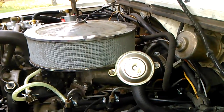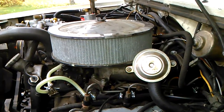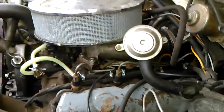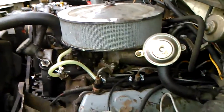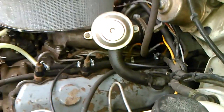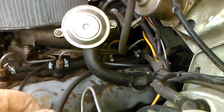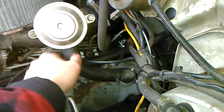I personally don't like that for this truck at least because it's got some blow-by and it makes me think something's on fire. I accidentally forgot to put this hose on one time and it was smoking from under my hood — it was just blow-by coming out of that tube and I thought something had caught fire. I believe it also can create an oily residue. The last variation is venting the crankcase with no CDR at all, just having an open road draft tube out in the air — basically where this isn't hooked to the CDR at all and you don't even have a CDR.